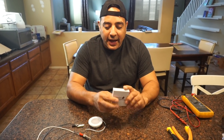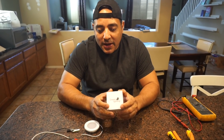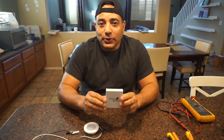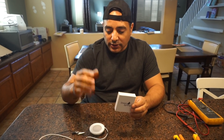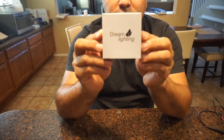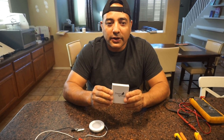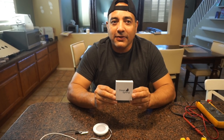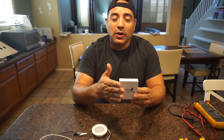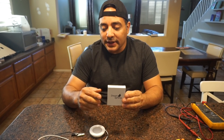Today we're going to focus on lighting for the main inside portion of the bus. We looked around at lights and chose a set based on color temperature, size, and brightness. The lights we chose are about 2.8 inches, they're rated for 200 lumens, and they consume about 165 milliamps at 12 volts. We're going to test them today to see how they work.